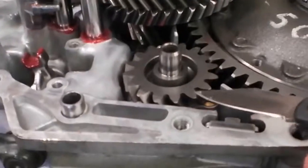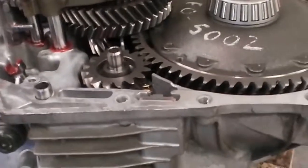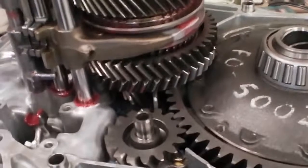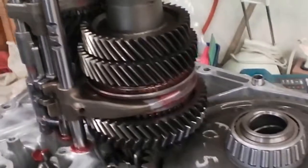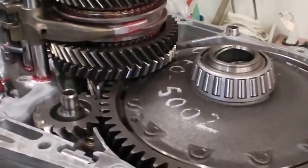This gear is an oil pump. It's kind of unusual. Most transmission oil pumps cycle the oil externally to a cooler. This one actually recycles the oil internally in the transmission. The shafts are hollow, so everything is very finely lubricated. We've been running Redline's manual transmission lube in this system with the Auto Cermet, and everything really looked very, very good, with the exception of the missing teeth from the over-exuberant driver.